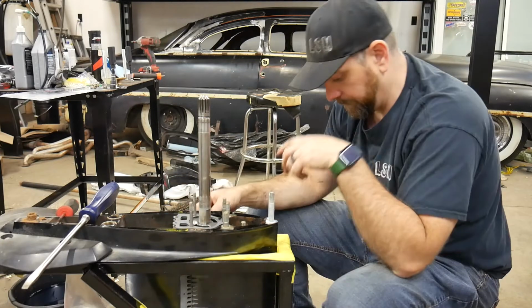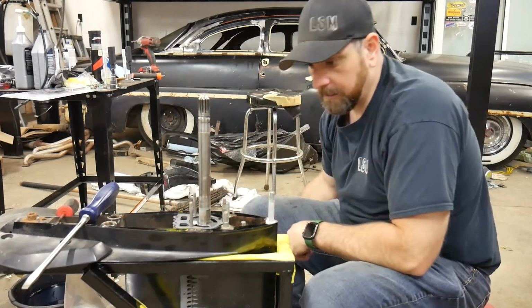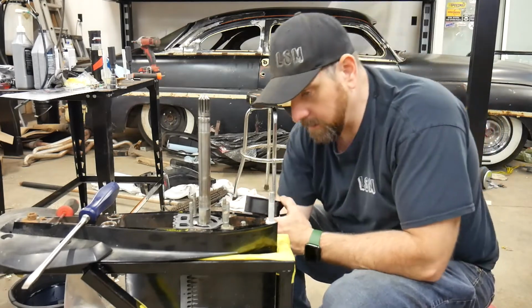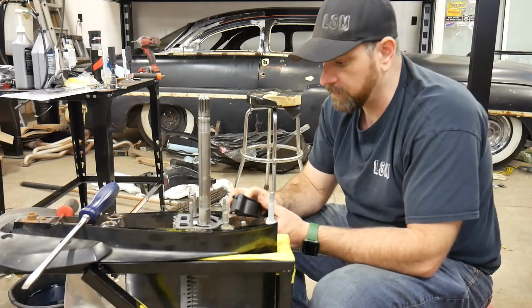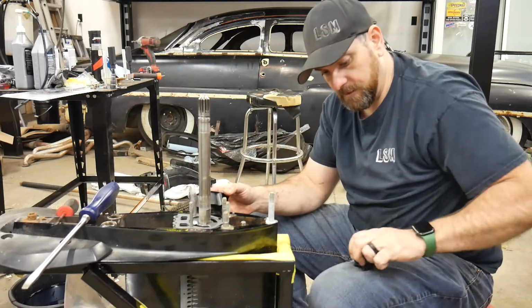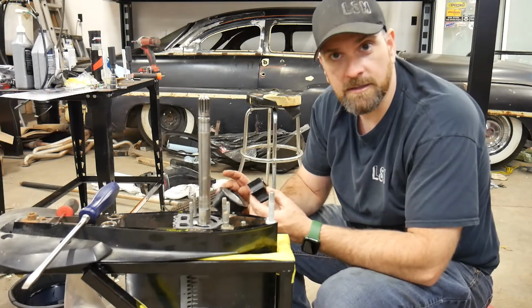Put that down. Now we're going to use that, like I said, that brass impeller and the Quicksilver housing. So what I like to do, and unfortunately I don't have it with me, you can really use any kind of grease on this, and I like to lube this up because it might be a couple days before I start this up. I hate starting these up dry.